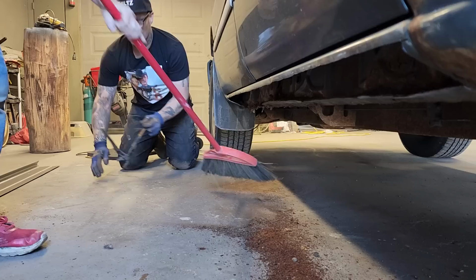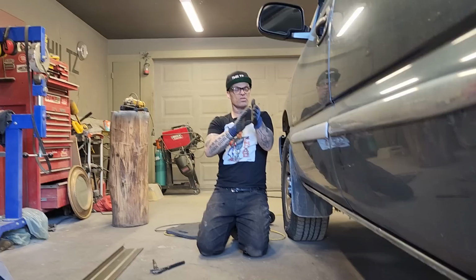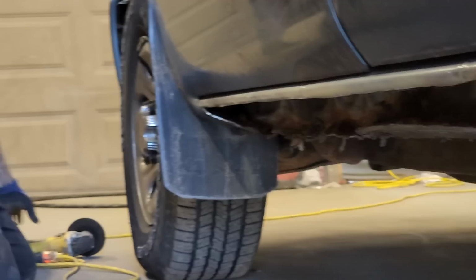So there's metal going down to that lip on the inside, spot welded together on the lip for the floor coming down. That metal is on there really good with the spot welds. So I'm going to cut the metal right close to what's going on, get more rust out of it, and then we're just going to take the hard disc and clean it off. Because if we start bending it, we're going to start ruining the flange on the inside sill. And once you ruin that, then you're into fixing underneath and then outside also. We don't want to go there. We're going to do the cheapest, quickest way possible.